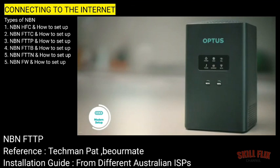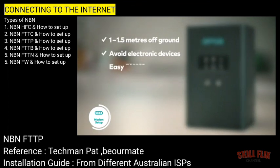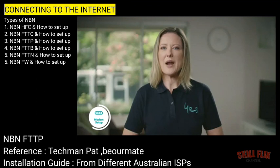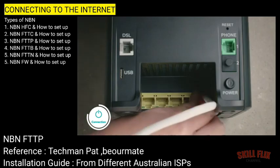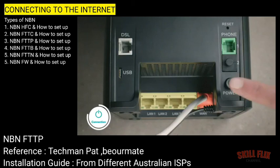To get that signal sweet spot, your modem should be 1 to 1.5 metres off the ground and situated away from large electronic devices such as TVs and speakers, somewhere easily accessible and well ventilated, as well as safe from any bumps or knocks. If you've arranged a professional installation, an Optus technician will connect your modem as a separate appointment after the NBN network installer has completed their work. Otherwise, simply follow the step-by-step instructions included in the kit to get connected yourself.